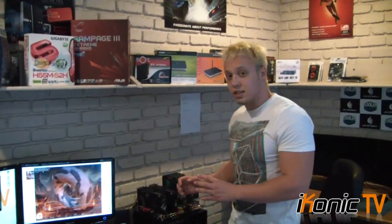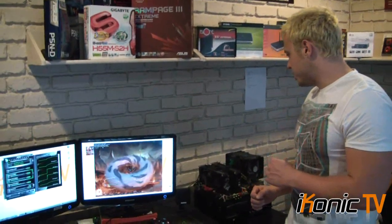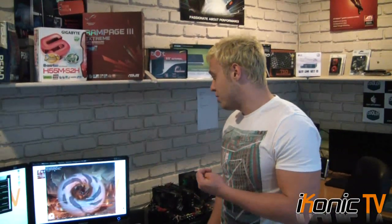So this was the max I was able to get — about 25 to 30% overclocked over the default, not counting the factory overclock it came with. The standard GTX 460 is a huge value for money in terms of what you're able to get after taking it home. Not many cards can even think of achieving a 30% overclock, so that really is impressive. This has been the Iconic TV overclocking guide — thank you for watching.